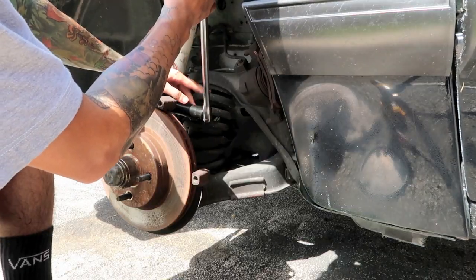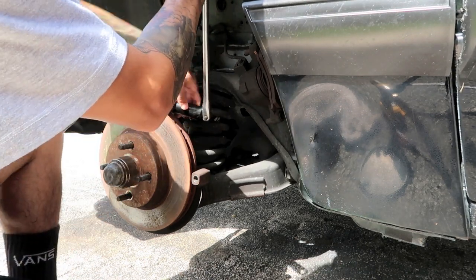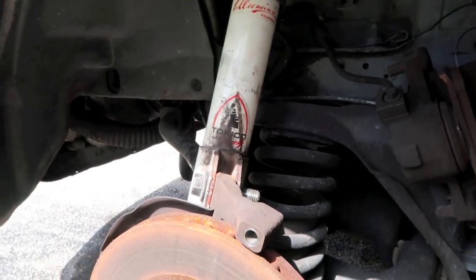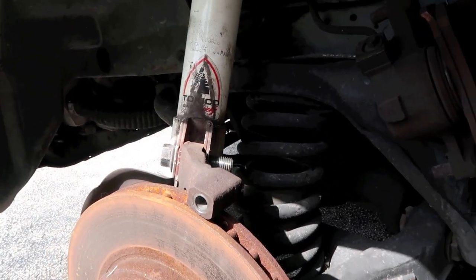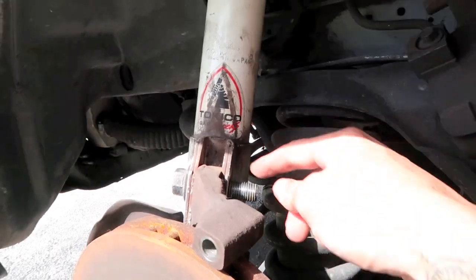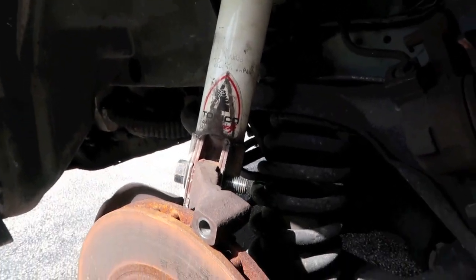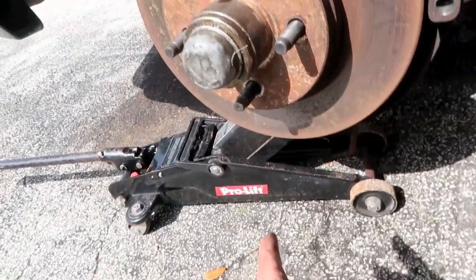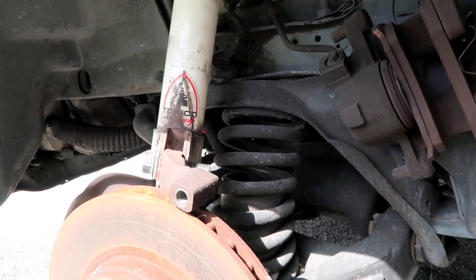The impact wrench failed so we're going old school with some good old leverage. The first battle was fought and we came out victorious. These two nuts that are attached to the bolts that hold the shock to the lower control arm were way tighter than I would have wanted them to be - and it wasn't even like they were tight just to break loose. Once I broke them loose they continued to be a pain in the butt all the way through the threading. But we got them out. The next step is to knock the bolts out and then lower the lower control arm. I already got the jack underneath it with some pressure, and that should allow the spring to come loose.